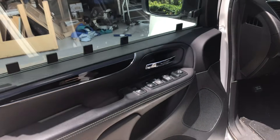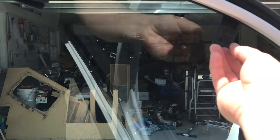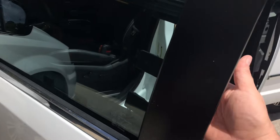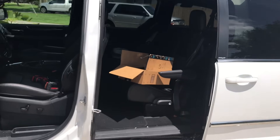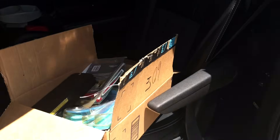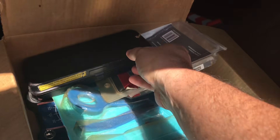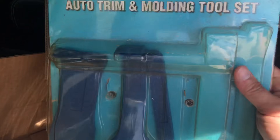I'll try to film as I go — pretty simple process. Right now my window is shimmed up there. I used shims from my flooring — pretty simple little shims — jammed two of them in some places and that's been holding the window up for the last four days until this part came in. The tools you're going to need are a power screwdriver or drill, and some of these shims, which you'll need if your window just fell down. These auto trim and molding openers will help you avoid breaking plastic pieces off your door.